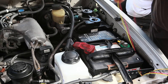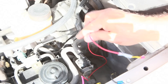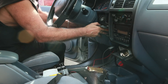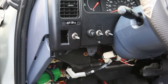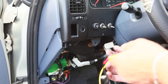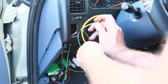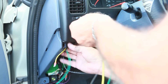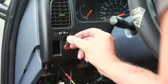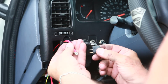Let's route the rest of the wiring towards the cabin and pull it through the alarm wiring hole until it comes inside the cabin. We take the bottom dash cover out of the way. Next is taking the pre-wired harness attached to the alarm light and sliding it through a hole the size of the light barrel we drilled in the plastic dash. The harness contains connections to the power switch, amp meter, and ground. The switch has a red wire that you connect with the power cable of the fuel pump relay, fuel pump fuse, or any other switched power source.